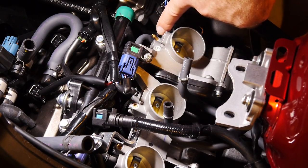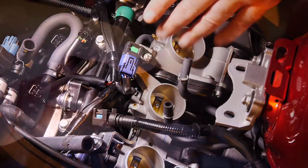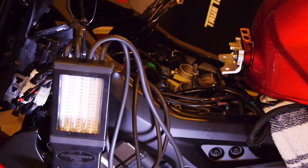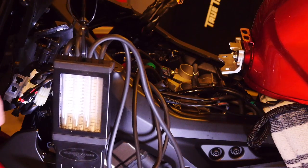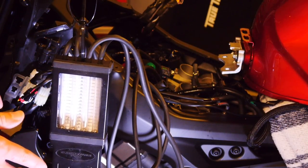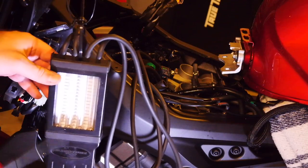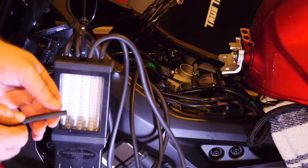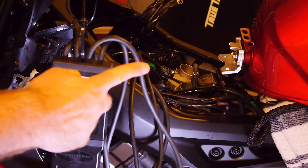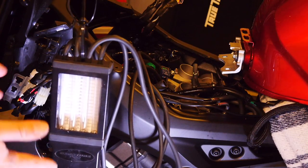Pull those two caps off, connect the tool, and then we have to idle the bike — let it completely warm up and wait until the idle RPM comes down to its normal level. Now we can reconnect our ECU. The tool needs to be hung straight and level, just allowed to hang — I just put a couple zip ties on the end and drape it off my handlebars. It does not matter which line you put on which cylinder at all, just remember which one you made the master. These do not need to be clamped to the engine — just push them on the nipples. Carefully idle the engine, bring it up to temp, and keep a hold of your tank so it doesn't go anywhere. Once the idle comes down to a normal idle, we're ready to start our reading.